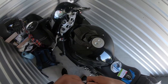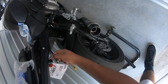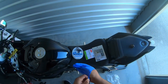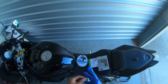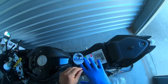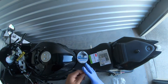Should be a quick easy job. Also, I'm going to give her a bath — I have not washed this bike since I had it, so shame on me. Now, these lights have a blue housing, which from what I read means at nighttime they won't give you better output than stock, but they give you better visibility at daytime. Since I'm mostly riding in the daytime, this will make me more visible to oncoming cars. Just know that if you're going to be riding at nighttime, this probably won't have as great light output as your stock.